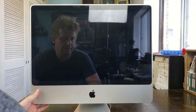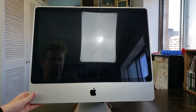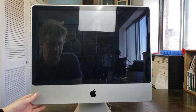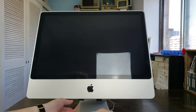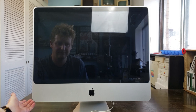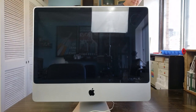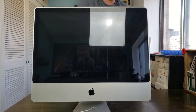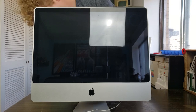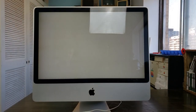Try and make sure the RAM is actually in the socket. Same thing. Try swapping them around. And still nothing. So I put the original chips back in, and it still wouldn't turn on. So what I ended up having to do is get up, go around the back, unplug the power source, plug it back in, and then it turned on. And I thought, you know what, this should work the same thing for the 2GB sticks. So I went and I tried to do that, and even with the power coming in and out, nothing with the 2GB sticks. So back to the 1GB.